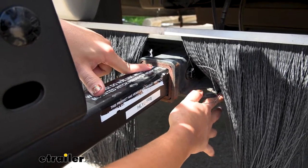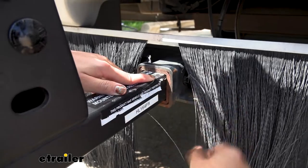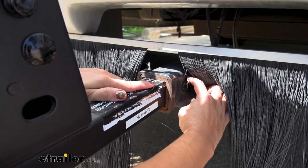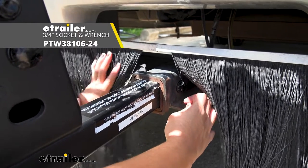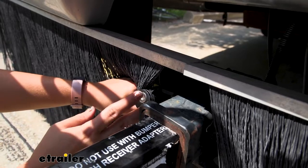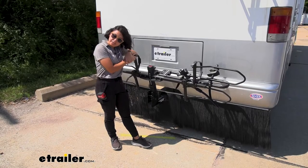You can see here the two-inch shank fits into your two-inch hitch receiver — make sure it's a frame-mounted hitch and not a bumper adapter. We have a three-quarter inch bolt that goes through as your anti-rattle bolt. We have extra three-quarter inch sockets if you need one, and there's also a lock at the end of the bolt that keys to the locks on your frame mounts.